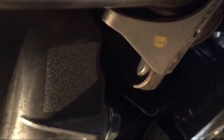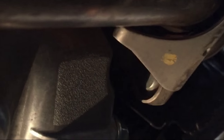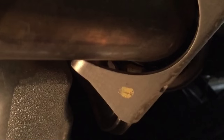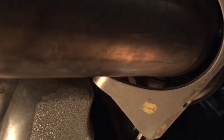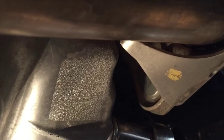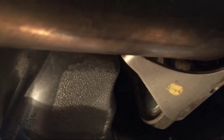I like to turn on my car for about 10 minutes and get the oil warmed up a little bit so it'll flow a little bit easier, but I'm going to try to do this with one hand. This bolt may be pretty tight, but I'm going to pre-loosen it. That's a 17mm socket. We're just going to open this up and the oil is going to rush out. And towards the front right here is where your oil filter is.